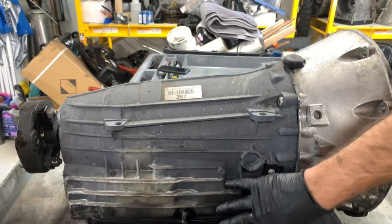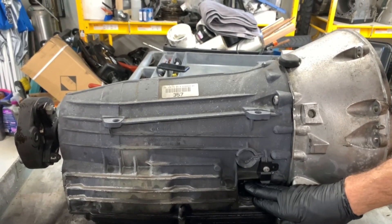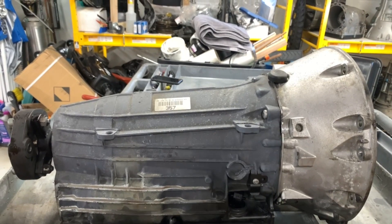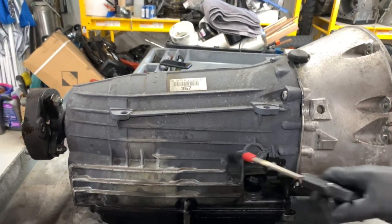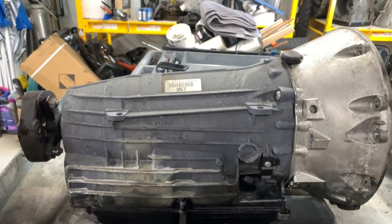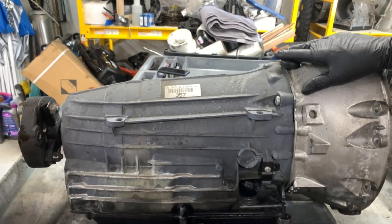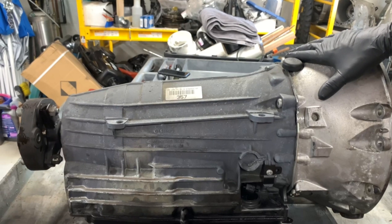The first thing we're going to do is go ahead and carefully remove the valve body and the conductor plate or TCM. Then we're going to do a careful air check to give an evaluation of the different clutches, and we'll go through that very carefully. Then of course we'll disassemble the unit, wash the components carefully in safety clean solvent, and blow dry them and inspect them carefully.